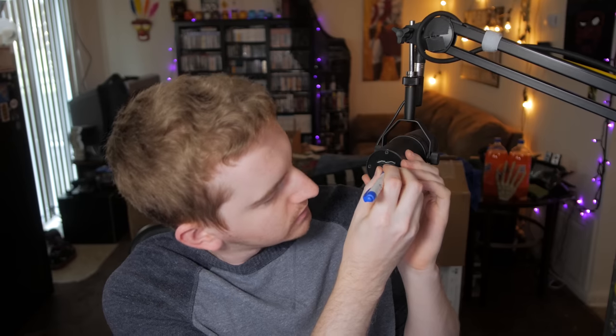Now this is the microphone with the presence boost on and the bass roll-off on. You can probably tell I no longer have quite as boomy a voice. Even with the proximity effect, not so much — it sounds a little thinner, it still has that punch to it, but you don't have any of the boom or rumble more commonly associated with radio. Now both switches are off — this microphone is set to completely flat. This is a microphone test. My name is EposVox, you're listening to WVOX. Doesn't sound quite the same.